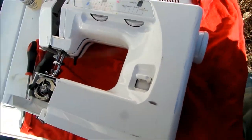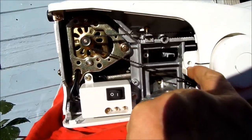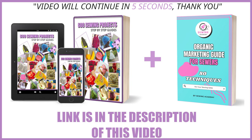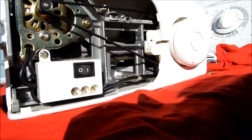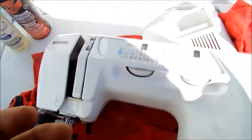In order to get this front panel off, if you want to do a detailed lube, basically there are a few screws you need to loosen. The main screws — this one here you have to take all the way off, one of the few screws you have to take all the way off. This one here you can just loosen. There's one screw here that holds this panel on; this screw should just pop off. Then we have this screw here, and two screws underneath here.